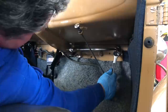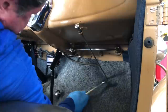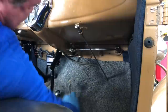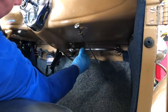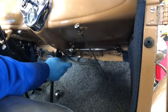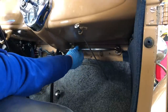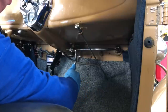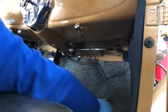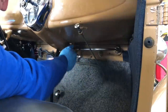Now that it's done right, Henry Ford would approve of this. You have to tighten these fairly well because you're depending on that to not leak. It's actually pushing this pipe against that fitting because it has kind of a nipple shape on it — free the nipple. Tighten this up and get it good and snug so that the metal pushes over that nipple and you don't get a gas leak. And no, you don't use plumber's tape on that — that's not a good idea. After you tighten it, let it sit for a few seconds, come back, and you'll be able to get another little snug on it. That means the metal is bending around that fitting — it is not going to leak no matter what.